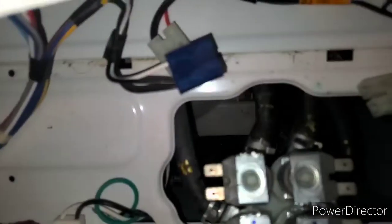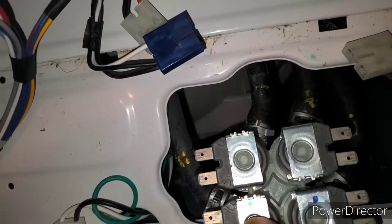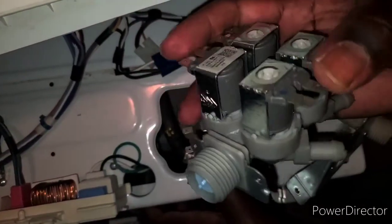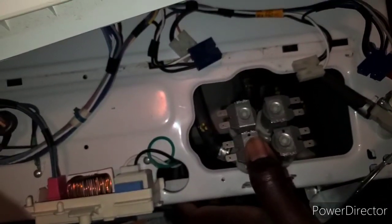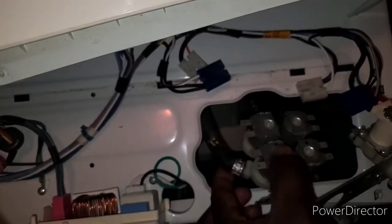As you can see back here, you have four hoses coming off the valve — one, two, three, four. You need to make sure that you put tape — different color tape — on these hoses so you know which hose goes to which valve. When you put the new one in, you need to make sure you know which hose goes on the right one. There are four of them so make sure they're on the right ones.